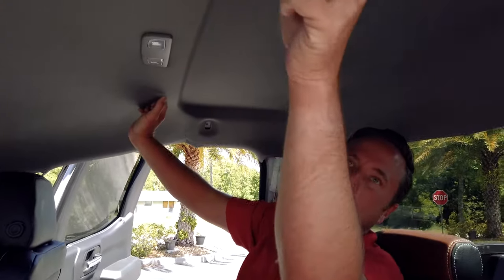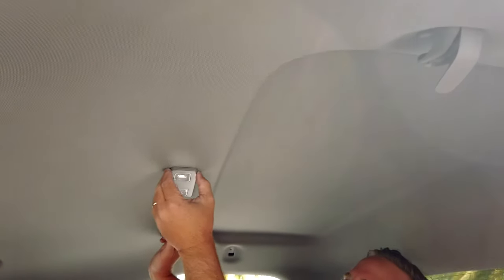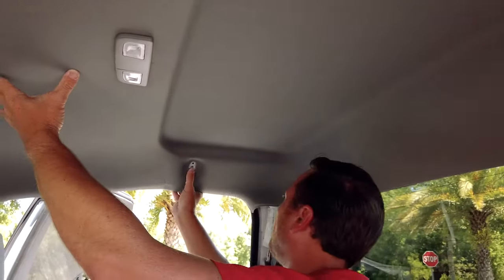All right, guys, what I did to get started is I put up this first coat hanger, the driver's side coat hanger. I did pop in the dome lamp here. Make sure this is nice and flush with the headliner before popping it in. And then there's two little push pins back here. Pop these in as well. And then the coat hanger over here, put this one in.